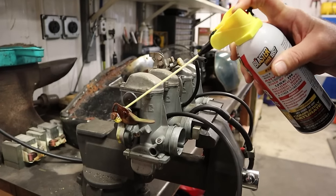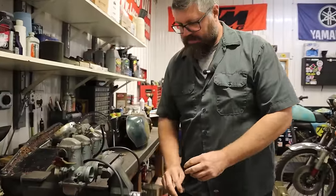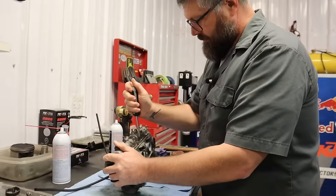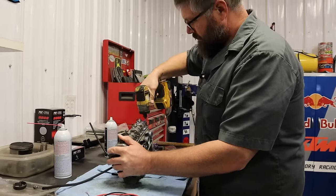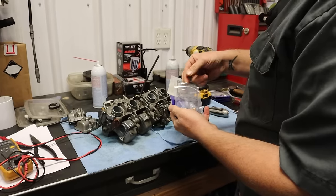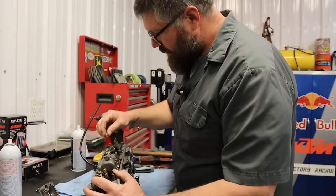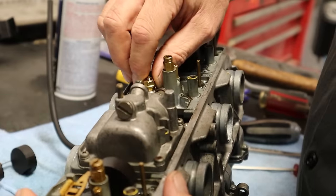Let's look to see if they have a carb kit at WPS. I'm going to put some penetrating oil in here to see if we can get that choke lever to work. So we need to get these carburetors to stop leaking gas. I'm going to take these apart for the umpteenth time. We're going to put a gasket in here on the one that didn't have a gasket. These two are leaking through the needle valve, so we'll replace this old needle and seat with a new one and hopefully it will no longer leak. Adjust the float height a hair — doing the lazy man's carb rebuild, only replacing what's needed.